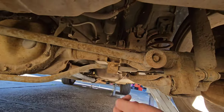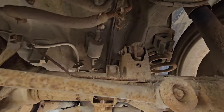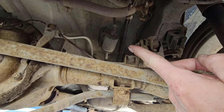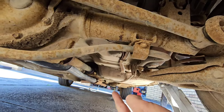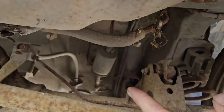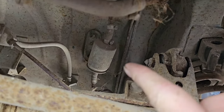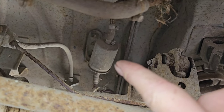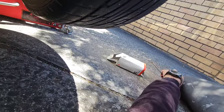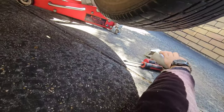So it's really hard to see where they are. Let's give you a bit of a look though. The fuel filters on the old Commodores are tucked up just past the fuel tank, or just outside the fuel tank, and just before they hit the metal lines and run up to the motor. So we're going to get him out. You can see he's got a couple of little flathead screws. We're going to undo them, and I'd undo them with the screwdrivers, take it out, and give you the best look that we can.